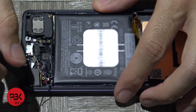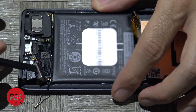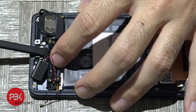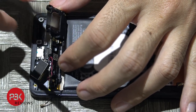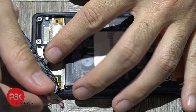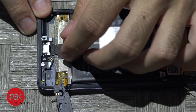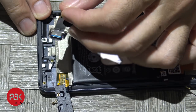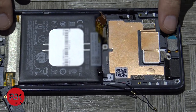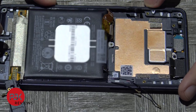Go ahead and pop up your vibrator from the frame — it's just held on with some adhesive. Now at this point you can lift this plastic piece that's holding your speaker right here. Now at this point all you're left with is your charger right here which you can just lift up and pull out. You've got your battery right here, your earpiece over here, your front-facing camera right here, and your screen that's attached to the front of the main frame — the mid frame over here.